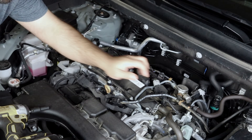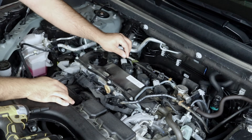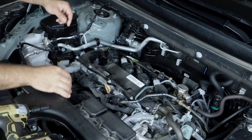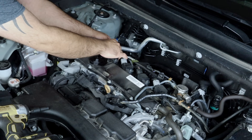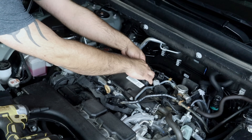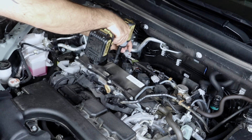First we're going to remove the four coils. One thing I'll mention about the coils: for as long as I can remember, Toyotas have always had 10-millimeter bolts holding the coils, but on the A25A they are 8-millimeter — not a big deal, just thought I'd let you know. Let's remove the connectors, which are also improved and much easier to remove and they don't break as much as the old ones. That's four ignition coil connectors disconnected. Now let's remove the four 8-millimeter bolts.